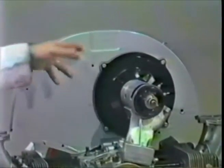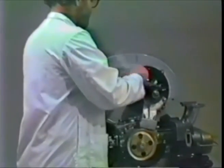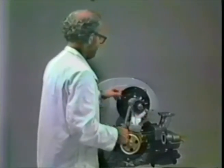The way to put this on is just put the fan shroud and generator combination on, put the nuts in loosely, and once you get everything kind of arranged, tighten down the 6mm bolts that hold the generator to the fan housing. That way, if you tighten them down evenly with the generator on its stand, it tends to arrange things a little better than if you just torque down the generator on the fan shroud without it being on the engine. Get them fairly snug. This particular bolt here is covered up by the oil filter can strap and bracket, so you can use an ugly one there if you want to. Make sure the generator spins freely, which it does. Make sure the fan shroud is down.